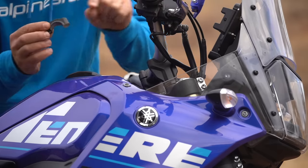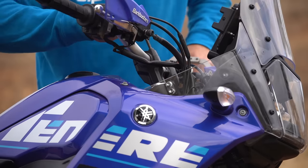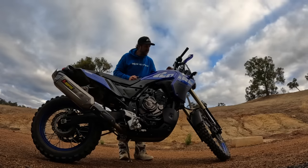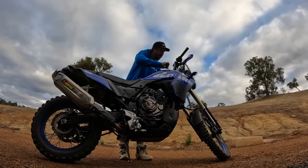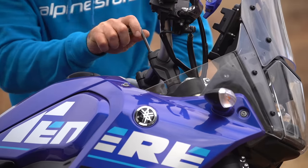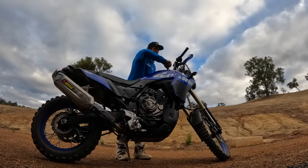That platform end — I always put it to the top; there's a little dot, just put the dot to the top. Always put that one in first. In doing it this way, it doesn't need huge pressure — you can literally just nip it. Now the clamping side is where the power comes in, because you have the spring tension of that clamp perfectly going around the bar, and it can close this gap without needing much. About four of those little turns on the aluminium — and look at my leverage, it's not much, so I'm not going to overdo it or snap anything.